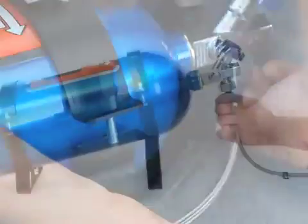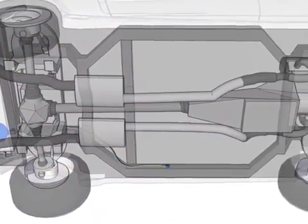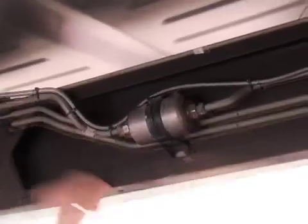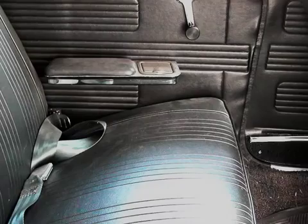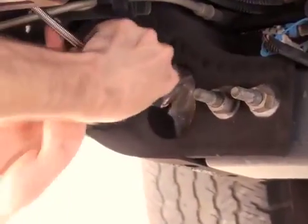As you plan a route for the high pressure nitrous line to travel through the chassis of the vehicle, keep in mind that taking paths through the underside of the vehicle are generally shorter but require more safety binding and strapping points. In most cases, following the fuel lines along the frame of the vehicle will work best. Paths that send the line through the vehicle interior will often use more hose length because they bend and turn along interior contours. However, internal routing usually requires less securing and safety strapping, as you'll be able to tuck the hose into crevices and under interior panels or carpeting. Ultimately, you might want to choose a path that allows you to use the included hose length. Underside paths following the fuel line are recommended for most applications.